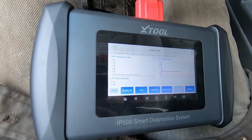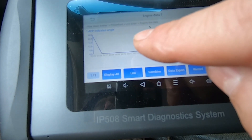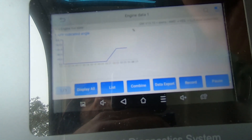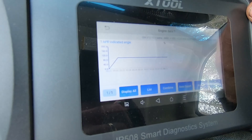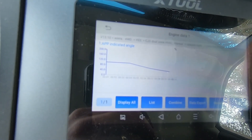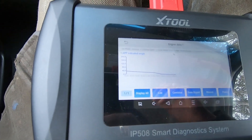I'm going to turn the vehicle off because I want to do foot-to-the-floor acceleration and see what happens. I've got a graphic showing the accelerator pedal indicated angle, and it's currently at 0% because I'm not touching the pedal. Now I've got the pedal right to the floor, and I should see a reading approaching 100% — and that's exactly what we see: 100%. Then I will slowly back it down, and that's a pretty smooth line. So that tells me the sensors are working properly, at least right now.